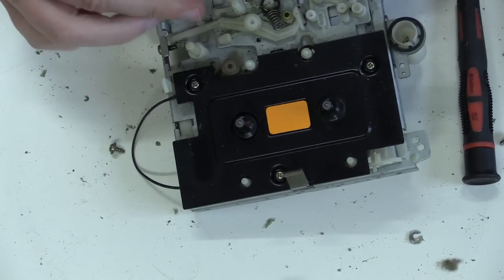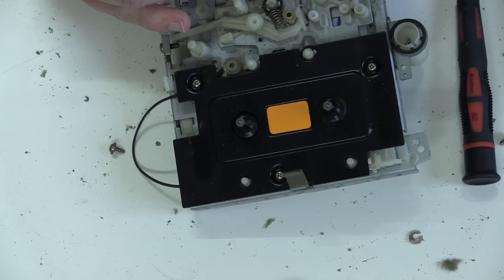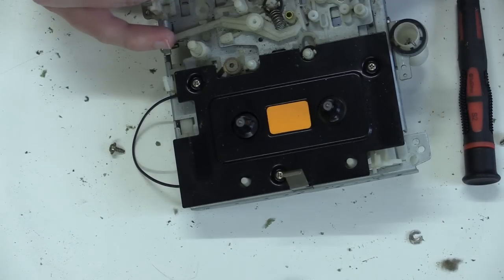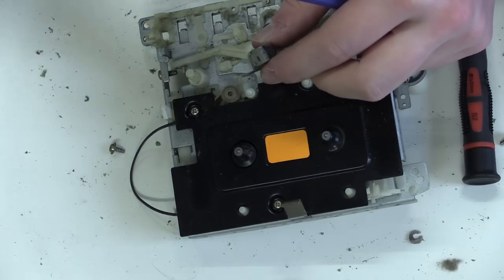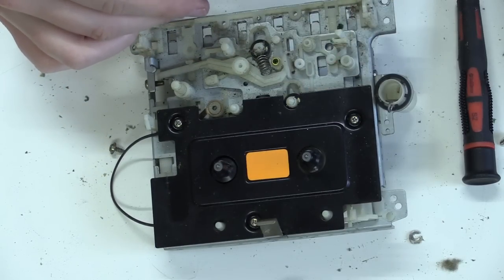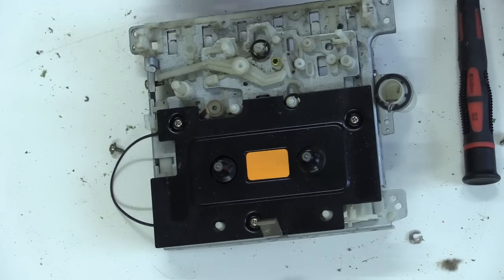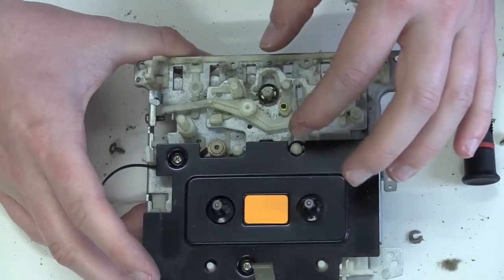There is the erase head — pretty decent condition. What I believe is a ferrite head — definitely not the really cheap ones with just a little magnet, or the cheap ones with an electromagnet in a plastic housing. This one is actually a nice one. Then this one is the playback head, secured in place. The azimuth adjustment is for tape alignment. Kind of dirty, but it does show some signs of use. As a replacement part it's going to be good enough.